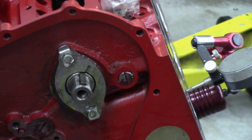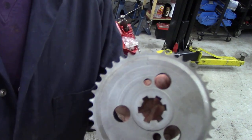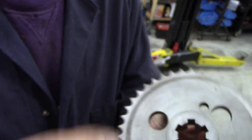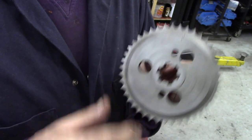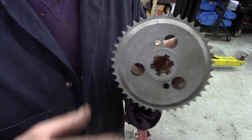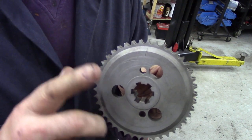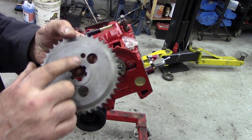Next we're going to get the cam sprocket. Very interesting how these go on — please pay attention. It's got a multi-keyway in here. Now this is for a petrol and a diesel. The petrol is marked with a P here and also on the keyway there is a P. When it comes to a diesel, you'll find that this is a vernier — that means you can alter the tooth pitch to get the timing absolutely spot-on correct by taking this off and moving it just one tooth, one keyway. You can alter the tension and timing in the injector pump because the injector pump was critical. But on the petrol, it's not really a big problem because you can move it around a bit. So we're going to put the P on the keyway.